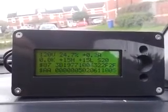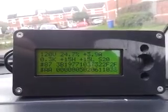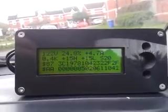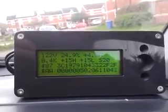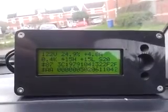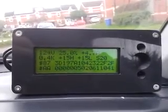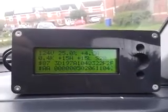I probably need to give a little bit of hysteresis — a window — and you can see the assist has gone off now and it's started its own sort of regen mode just to boost the voltage back up. So we're getting the behavior I want. I can possibly push the lower voltage envelope a bit more and squeeze another five volts out, but you can see the duration we had for the assist. I'm going out on a test drive of about 60 miles shortly — I've got to go to York, there are a couple of hills there, so we'll see how it behaves.